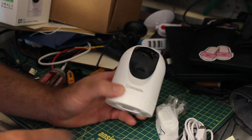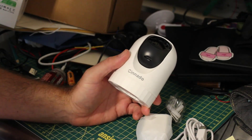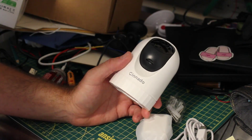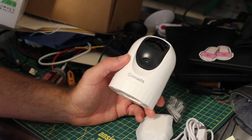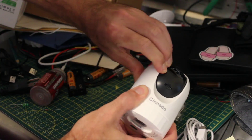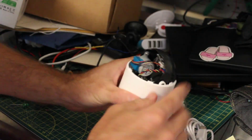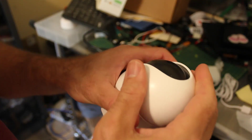This is the Sonato D1, but although you get this you might think it's the same — sometimes the hardware is different. There are actually two different models; you have to look at the board inside. All you have to do is grab around the lip here and pull a little bit — there we go, it pops off. You'll see right there that there's a chip that says T23 on mine. When you look at yours it's going to say either T23 or T31, and when you go to the website to download the firmware you have to make sure you pick the right one for your processor. Now I'll just snap the top back on.